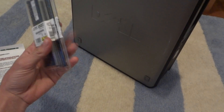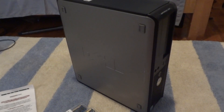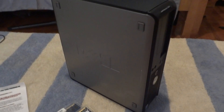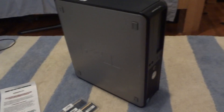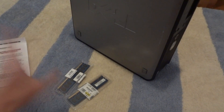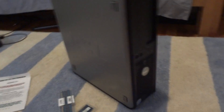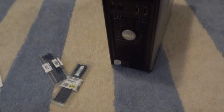We have 4GB of RAM here plus what's already in there. TigerDirect put four 512MB sticks in there, so those are going to have to come out. I'll be running about 5GB until I order the rest. I'm going to order another one of these probably this week. There's not a lot of videos out there for a RAM upgrade on the Dell Optiplex, so here it is — I'm going to open her up and get the RAM installed.